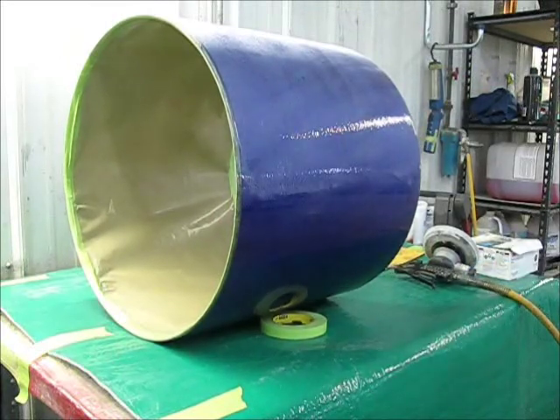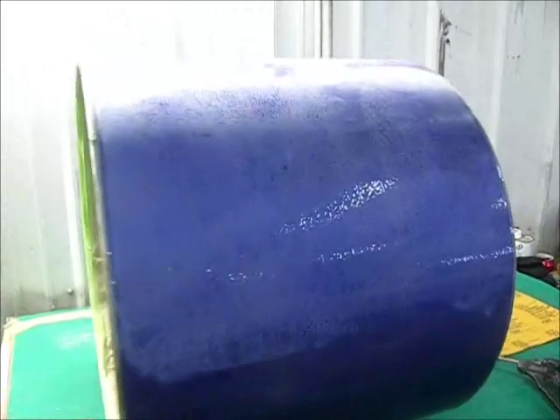1000 seems to be doing okay. One thing you'll notice is you can see how dull this finish is right here, but yet you still see shiny spots. Over here you see a lot more shiny than dull. Everywhere you see the shiny, those are the low spots — those all have to come out until the entire shell is dull. The trick is to get it down to where there's no shiny, but yet you don't go through the clear to the stain. I'll sand on this for a while, get it a little closer, and then show you what it looks like.